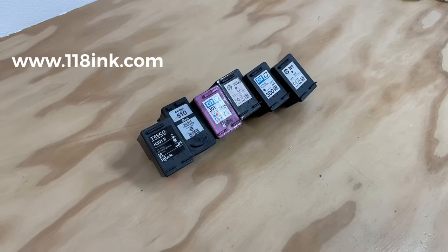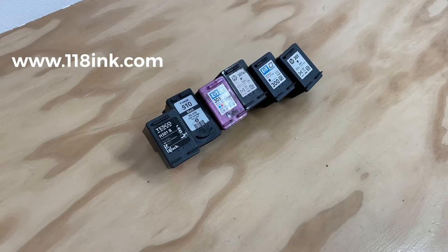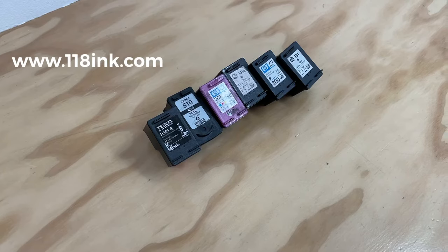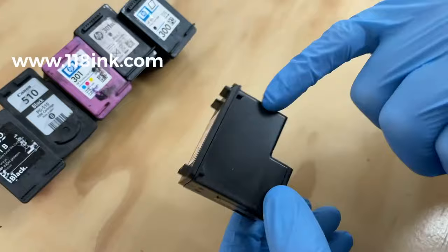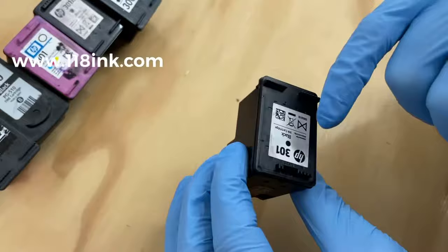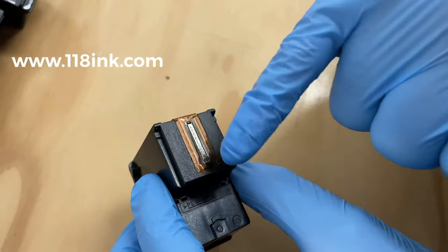Here's a video that I hope you'll find very useful. One of the biggest problems when people are trying to refill ink cartridges is the fact that they dry pretty quickly. At the end of the day ink is a liquid, and when it dries it gets very difficult to deal with. You could have a perfectly good ink cartridge — any ink inside the actual sponge is going to be fine for a long time because there's a tiny amount of air getting through. But the ink here on the print head dries pretty quickly.